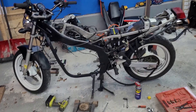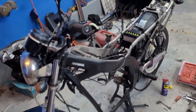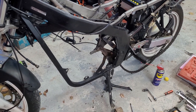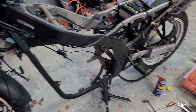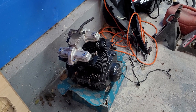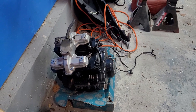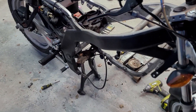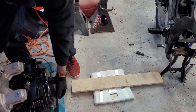The engine's out. It was a bit of a struggle — I had to take half the frame out, get the gas tank out, undo all the wiring under the chain, and there are actually quite a few bolts holding that motor in, which was pretty surprising. But it's out. I'd say that weighs maybe 130 pounds, so I should weigh that to compare it against the batteries and the electric motor. Now that it's out, it's looking pretty good, and I'll put the frame back together to see how much room I have for the batteries.